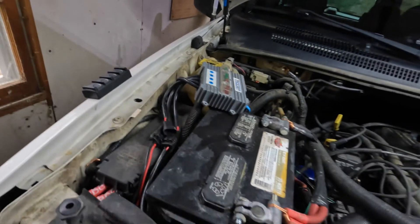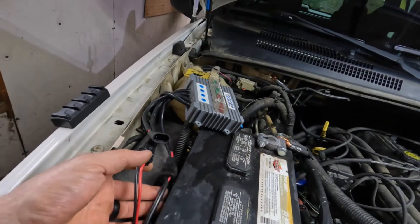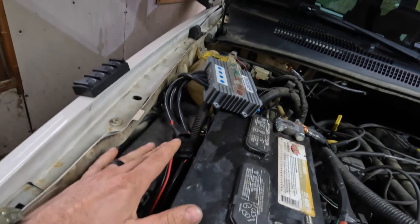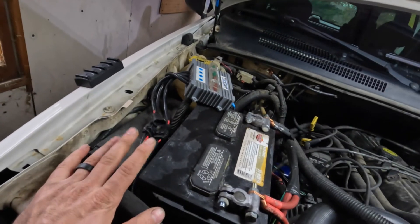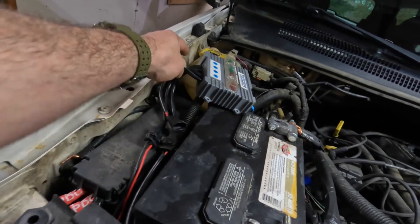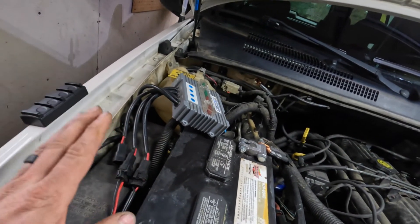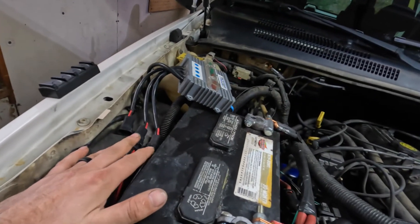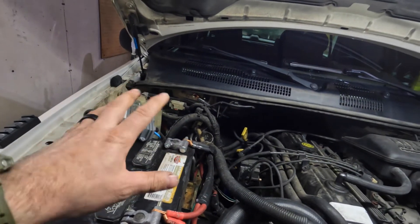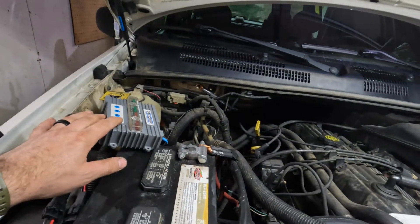You can hook up your lights to basically anything on the vehicle, or if you have a trailer you can even do it to that. This whole system comes with wires so it's really easy to keep everything organized. If you don't like what trigger you have set up for a light, you just disconnect it. There are four connections — I've got one running back, one empty that I have plans for, and two up front. Channels one and two are my front lights, and four is my backup lights.